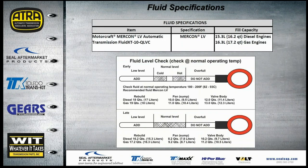This transmission takes Mercon LV fluid and I strongly suggest using it. A local shop was consistently using a good-name-brand synthetic with no issues, until one vehicle developed a TCC chatter they couldn't eliminate. They removed the trans, had the converter recut and rechecked, found nothing wrong, and still had chatter after reinstallation. Switching to Mercon LV resolved the problem.